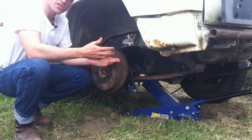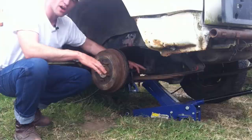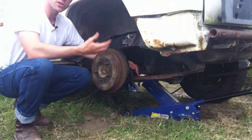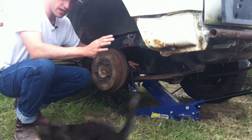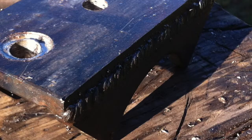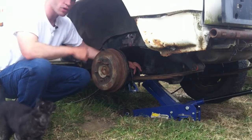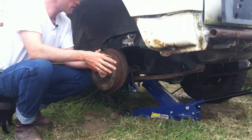Another aspect of the design is deciding how you're going to apply the springs to the axle. In my application I have a spring-under setup because that gave me the right ride height so that the front and rear fenders were approximately equal. I left my spring perches really short — about an inch over the axle itself — knowing I had originally planned to test a spring-over configuration. If you needed to bring it down you could make taller sidewalls on the spring perches, or flip them over on top of the axle to jack the height up more.